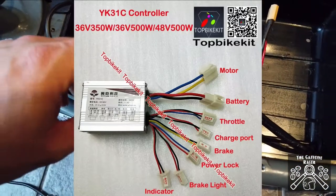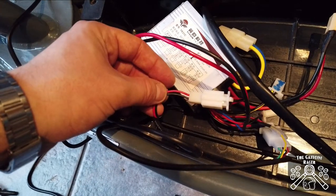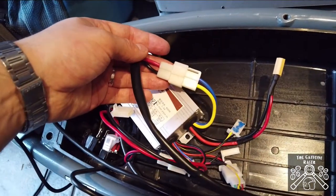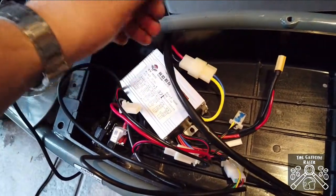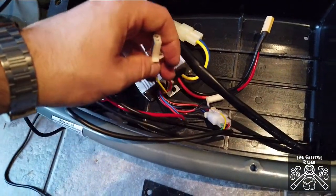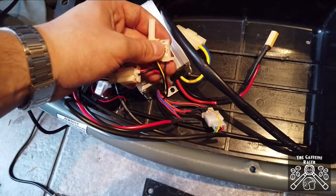With that ESC I didn't have to change over too many of the connectors. The charging polarity was around the wrong way, so I just had to pull the pins out on the plug and put them around the opposite way. On the motor as well, because it was going in the wrong direction — all you need to do is turn your positive and negative around the other way and the motor will spin in the correct direction. There are a couple of wires I'm not using at the moment: one is the brake light and the brake cut-off, which cuts power to the motor when you pull the brake.